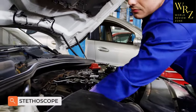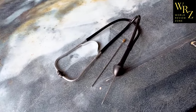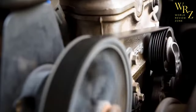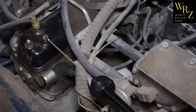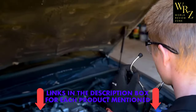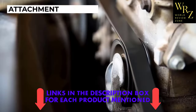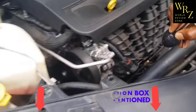It is sometimes problematic to detect an unpleasant sound in the underhood of a car — anything can make a noise, both an unadjusted valve in the engine and an alternator bearing. In order not to worry about an approaching engine overhaul, it is better to use a stethoscope. The device will help pinpoint exactly what knocks in your car. It has a length of 34cm and is made of metal and plastic.